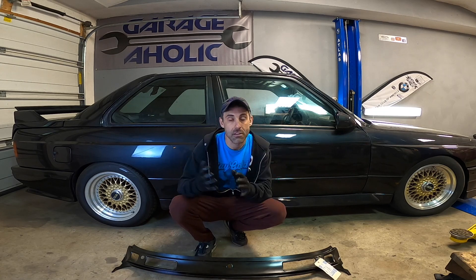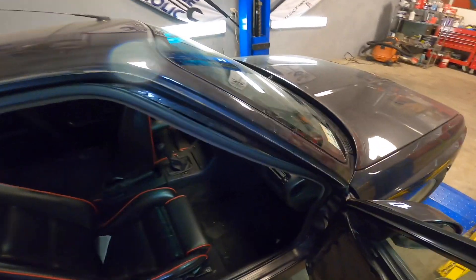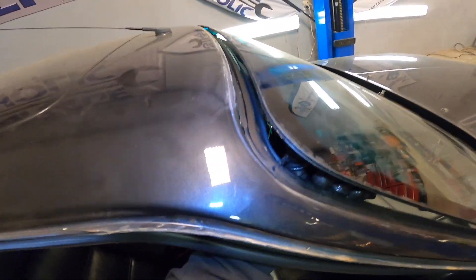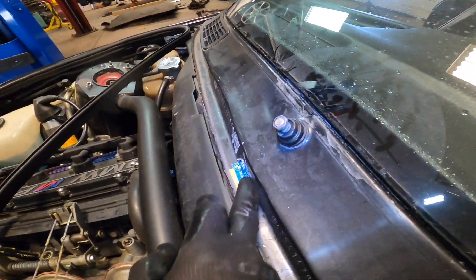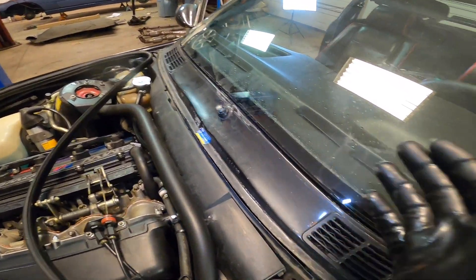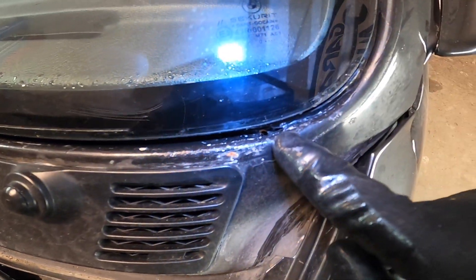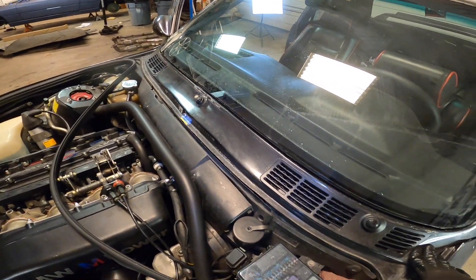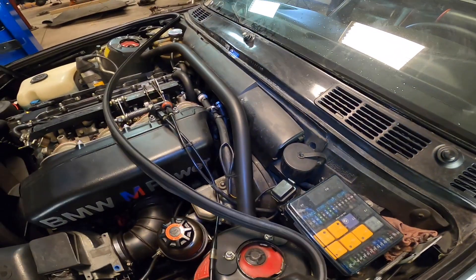In this case we're going to try to remove both the front and the rear glass and see how we do — we might be successful, we might not. We did have success at least for the front: this whole piece just kind of comes on up, which is great. You'll see what I'm talking about with the wave — it looks like it's been played around with, possibly due to the installation of the single wiper. Obviously we're going to a dual wiper setup again, so this piece is getting removed. And actually if you look underneath here, there was some rust down below. See that little hole there? Replacing this piece actually is a good idea — this is a very common location for rust to occur, so always keep that in mind when removing the windshield for whatever reason.